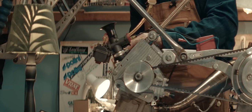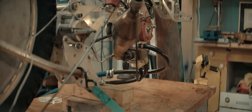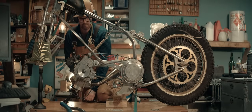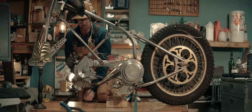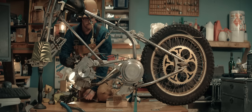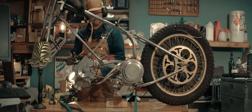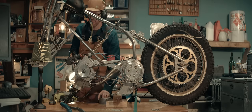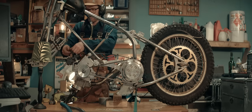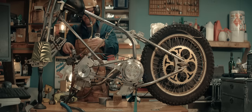I'll need a hose clamp here. I forgot the water. Open the door and turn on the exhaust extraction. It's all the way over there though. It probably doesn't help much, but a little bit. It's running lean, so just for testing now, I'll tape up the velocity stack, just to make sure it doesn't get ingested. Now let's see how it behaves now.